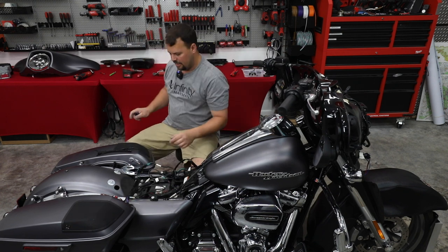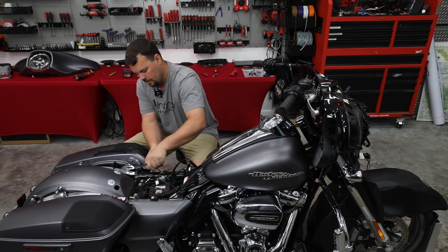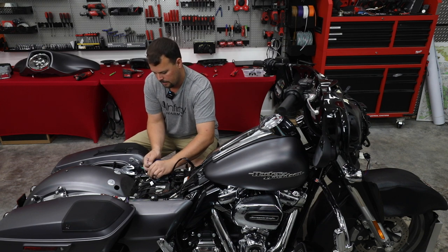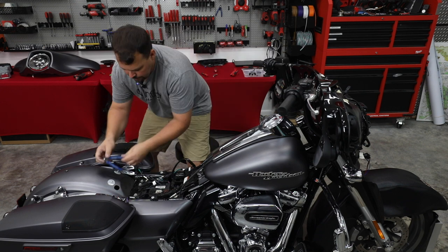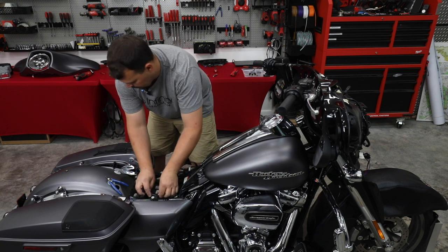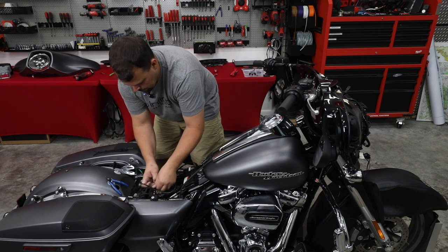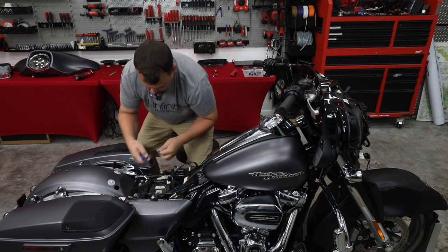So I feel like, you know, if they're gonna do something, we need to put it where they can see it. And then if they break it, you can blame them and make them fix it. All right, so we're gonna secure that one side down. Come over here, I'm gonna use this factory harness location. Again, I'm gonna leave this connector just outside of the bag. Now I'm going to bring these together. I'll bring them together over here by the ECM. We'll zip tie it to its harness. Let's go ahead and cut that again.